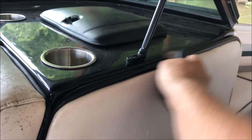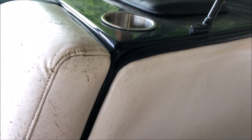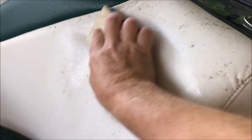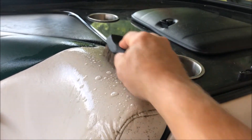You rub it in and let it sit for about 30 seconds, then repeat if necessary. You can see it's done a dramatic job on the vinyl already, and the brush is fantastic for getting into crevices I couldn't reach with a sponge. I've sprayed some on the vinyl seat and I'm using a sponge now — sponges really do a great job removing all that filth. It would be even better to wash the boat first with a sudsy solution to get most of the grime off before using the vinyl cleaner on the more stubborn stains.